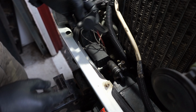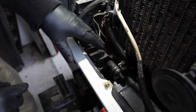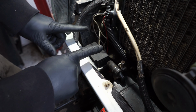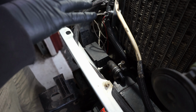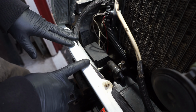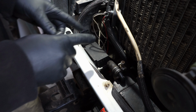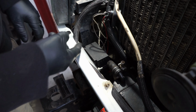So that's just hanging loose right here now just because I have the grill off. I want to be able to show everything. So yeah, it's pretty easy. I just drilled two holes through the front and then put some paint in them to keep them from corrosion, all that kind of stuff. Mounted bolts and nuts to hold this in place, and then used new wires. I think it was either 2 or 4 gauge. I can't remember exactly, but I redid the connection points on the other side down to the winch, and then routed my positive up.